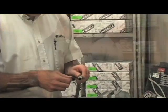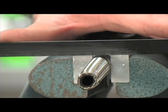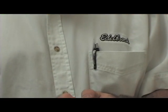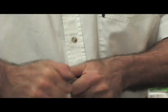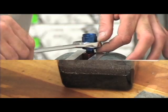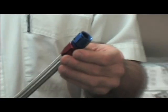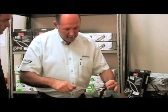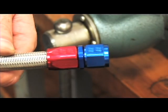The first thing you do is take tape, wrap it around the hose, then just take a regular hacksaw and cut right through the hose. Take the socket, start it on a little bit of an angle, work it around the hose, and squeeze it down — turn it backwards until you bottom it out. From there, put oil on the threads and tighten it down until it bottoms out against the red socket. The hose end is fully installed, and at this point all you need to do is wash it out with either a solvent or even soap and water and bolt it on.